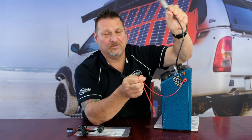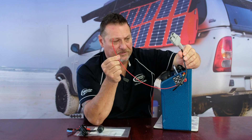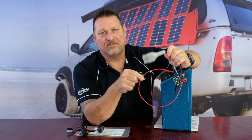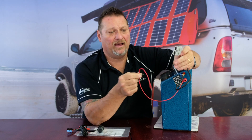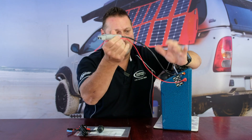It's very important if you're using the 20 amp circuit to have this connected to something controlled via the ignition. You could use an accessories circuit — accessories is essentially ignition-controlled — and it will turn on and off when you get in and out of the car. However, if you're camped up with the radio on using accessories, this would still draw power. If you connect it to a true ignition circuit, it will charge the power top while driving and turn off when you stop.